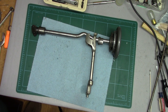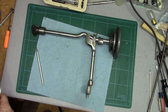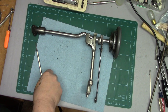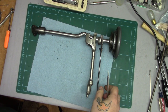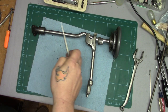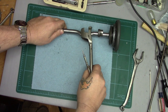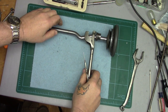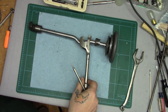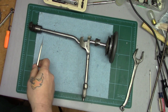In order to remove the main shaft, you have to loosen the set screw that holds the cam on — that's the cam that drives the fork for the stitch length regulator. So the stitch length regulator rod has to come out, that cam has to be loosened, there is a set screw on it. There's also a pivot point on the top of the machine and a bolt on the bottom that form the pivot points for the vertical shaft.